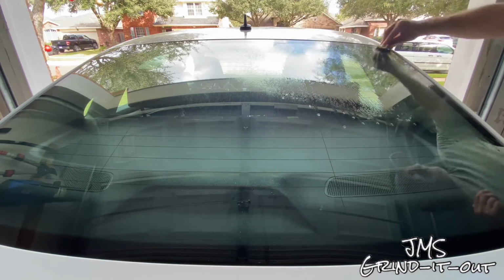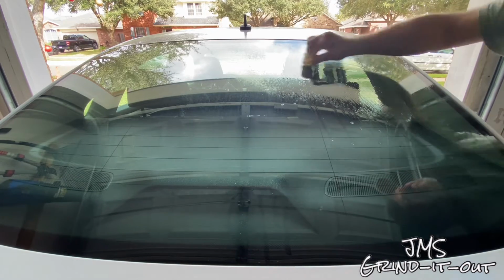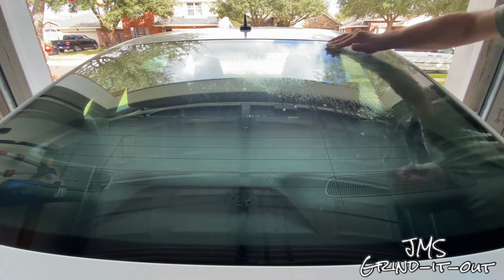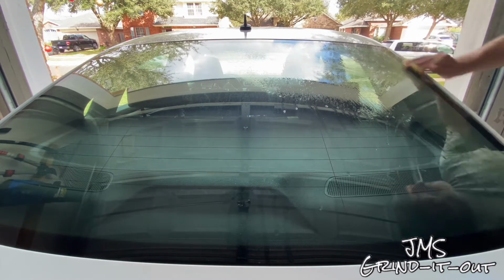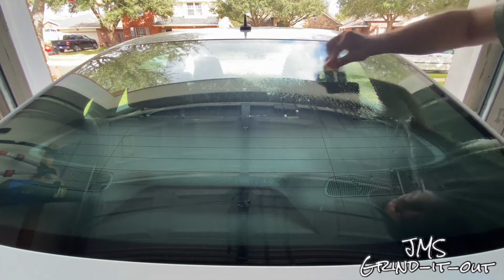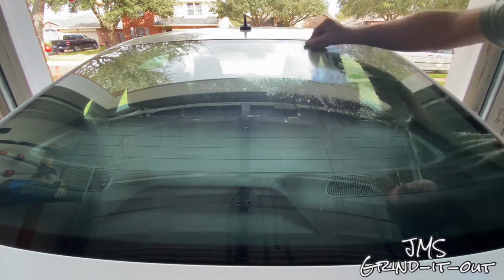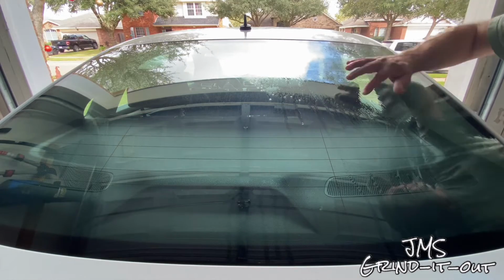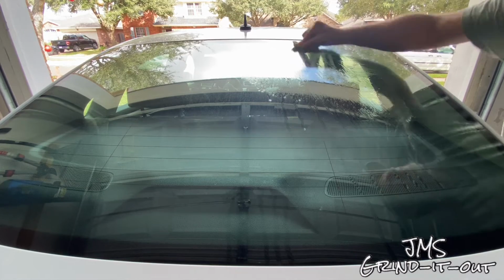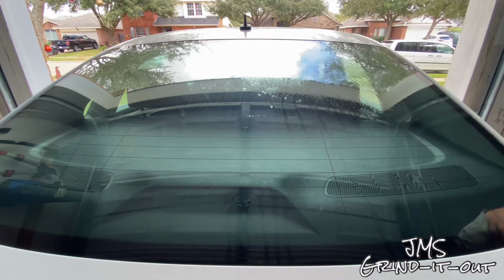Now keep applying the lubricant as the lubricant dries out. That's very, very important. So what you're going to notice is the difference between the place that you are doing now and the place that you haven't used the clay bar on. Just feel it. There's a huge difference already. So this is all it is. It's not a lot of hard scrubbing or anything. You just have to make sure that you go over it decently. Apply medium pressure. And if you find that the clay bar is getting some impurities on it, just turn it around, flip it over, do whatever. It's clay.